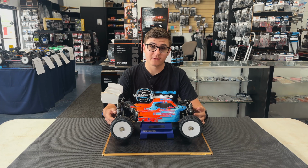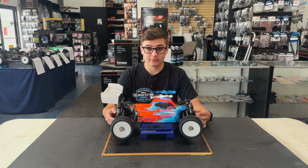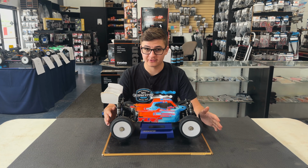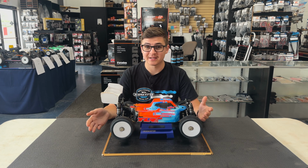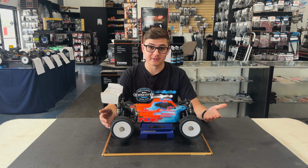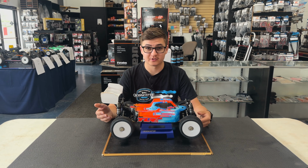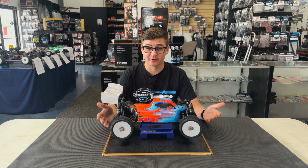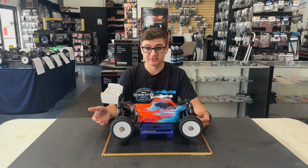In the front end of the vehicle, as you go to a thicker fluid, you're going to increase your on-power steering, but you're going to decrease your off-power steering. So what you're going to notice as we talk about this today is there's going to be give and take for each of them. So like I said, as you go thicker oil in the front diff, you're going to experience better on-power steering, and you're going to sacrifice some off-power steering. But with that thicker fluid, you are generally going to have a more stable car.